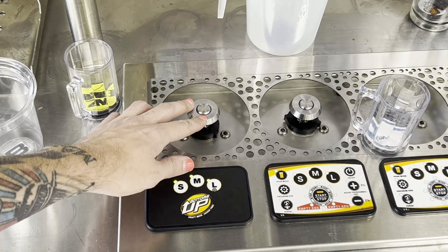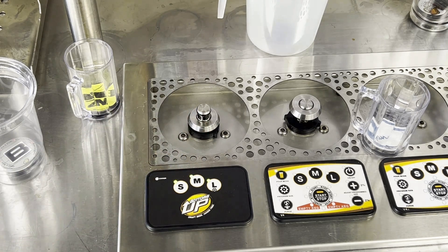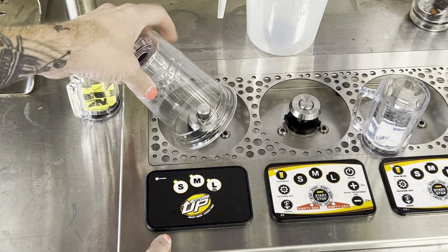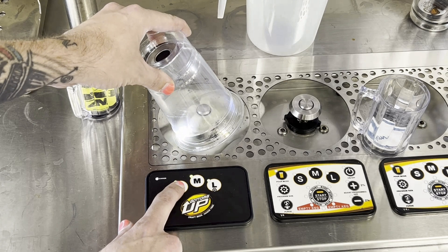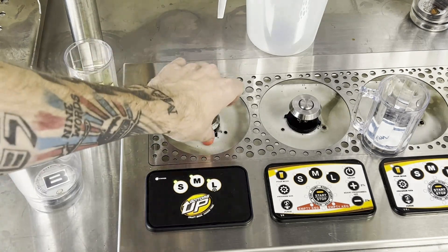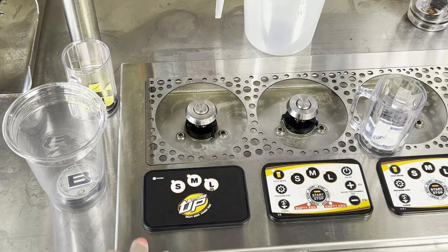Press down on the slider magnet on your cup coupler. No liquid is going to come out unless we tell it to. To get liquid out, you can press any button — I'll just press the S button. Wait until we have clear beer coming out. Press again to stop it, and then we've purged the system. To exit purge mode, just press the S and M buttons at the same time. Now you're back to the single light, which lets you know you're out of purge mode.